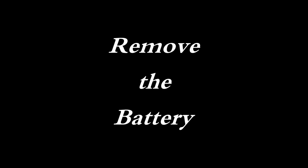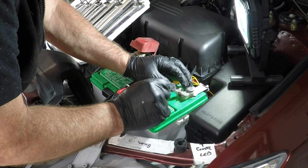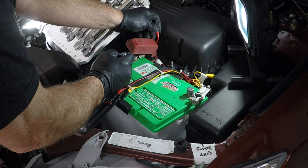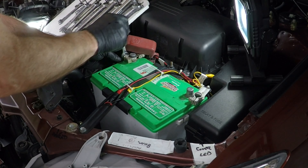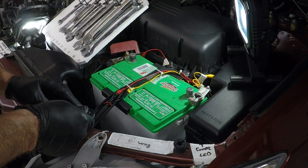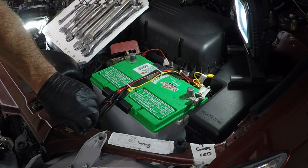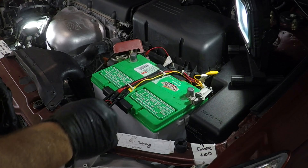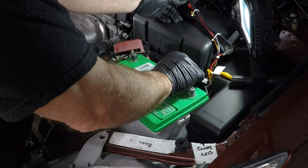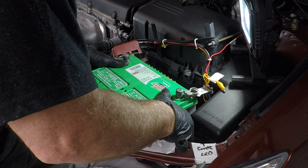The following parts will have to be loosened: remove two bolts to loosen the metal bracket below the battery, and the hood latch has to be loosened so you can loosen the entire metal support structure — that's what's actually holding both the radiator and the fan in place. Let's get started. First, remove the battery by loosening the bolt on the side of the terminals — the terminal will lift right up. Your car probably won't have all the extra wires you see here. Then remove the bracket that's holding the battery into the car.